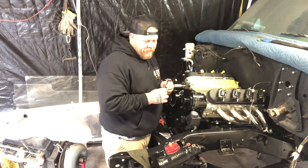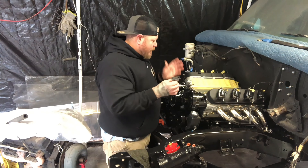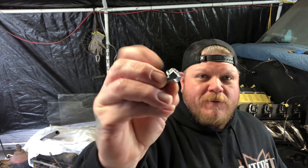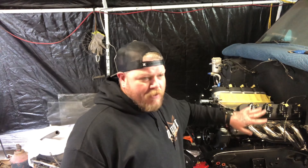That's still the throttle cable — that's another kit we're looking into right now, getting the proper throttle cable set up for this. What we're going to do is take this cam sensor and put a little assembly lube on the lower O-ring. That lower blue O-ring right there — we'll put a little assembly lube on that, work this down in, then hit it with the 10mm bolt and it should be locked in. That's kind of where we'll start our rear harness. We need to make sure we get it in and connected before we get too much stuff piled up.